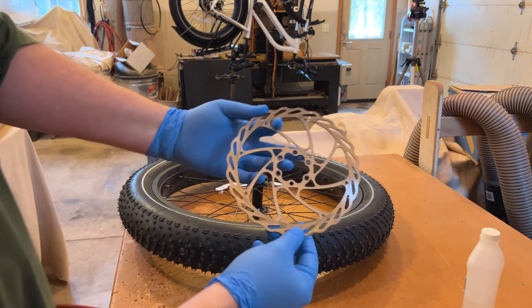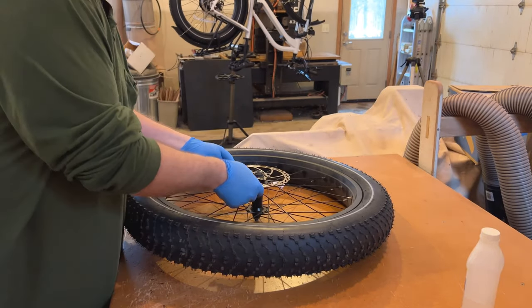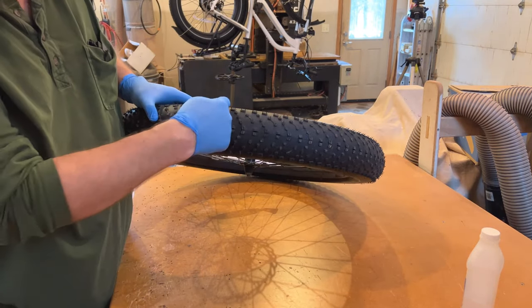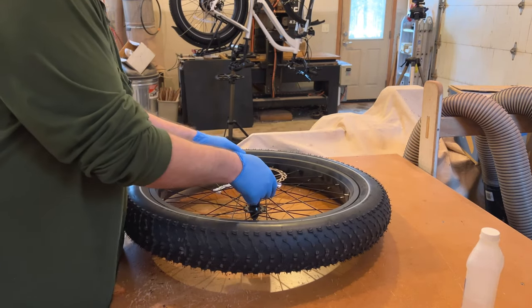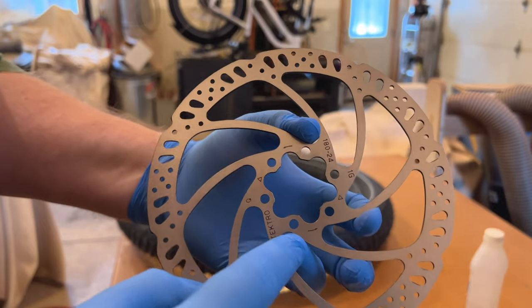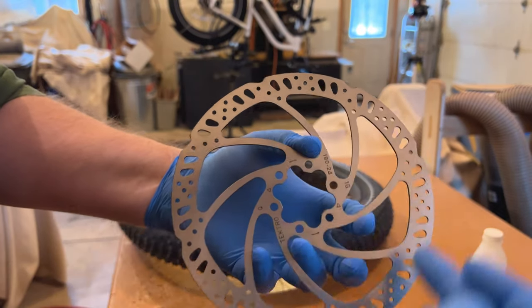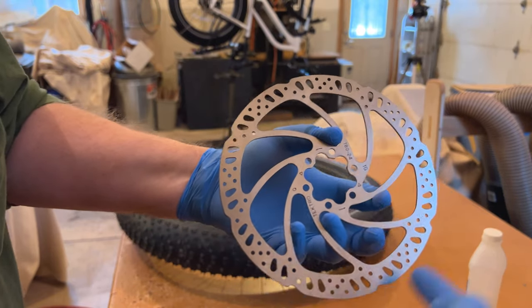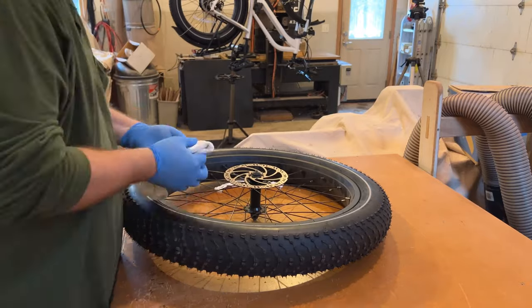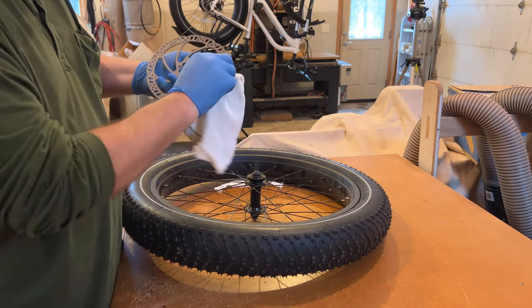Notice a couple things about the rotor: you'll find arrows that show you the direction of rotation of the wheel. The wheel rotates this way, and the direction of the tread goes the same way. So make sure you put the new ones on with the same orientation. Now on the new rotor you'll see arrows that show the direction and you'll see the size. Notice I'm handling it from the inside — I'm trying not to touch the surface. I'm going to take a little isopropyl alcohol and rub both the front and back, and also do it again once it's on the wheel. It's important you get all the oil and contaminants off the rotor as you can.